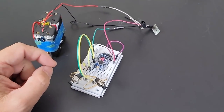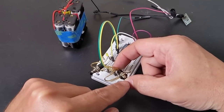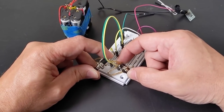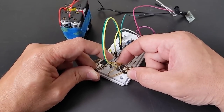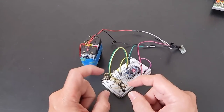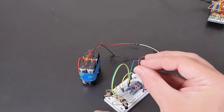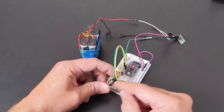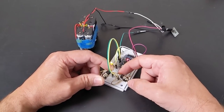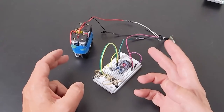The problem: we have the exact same phase issue as with the relay diagram. With running lights off, the turn signal is in phase. With running lights on, pressing the turn signal turns the light off — opposite phase. To fix this, I timed the motorhome's turn signals: exactly one second per full cycle, 500 milliseconds on and 500 milliseconds off. So I can program the Arduino: if running lights are on and a blinker signal arrives, wait 500ms before turning the signal off to put it back in phase.